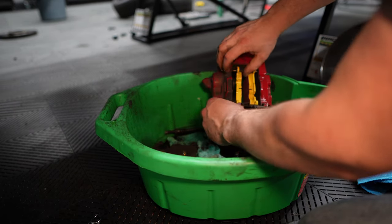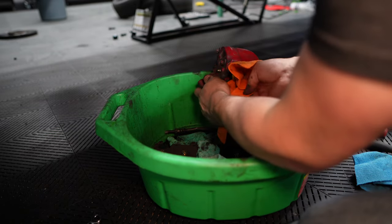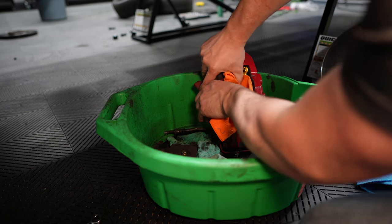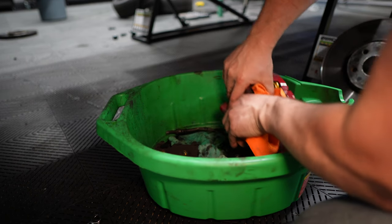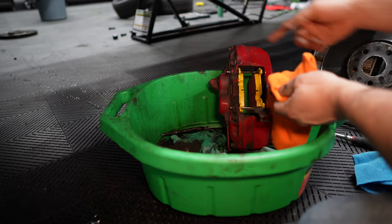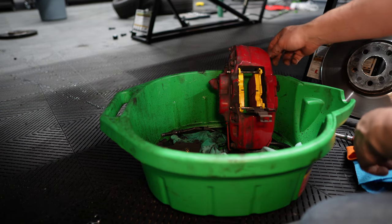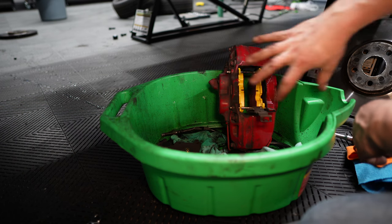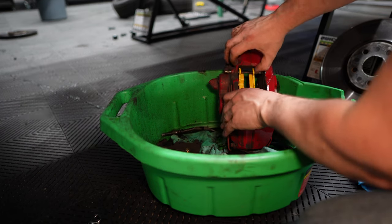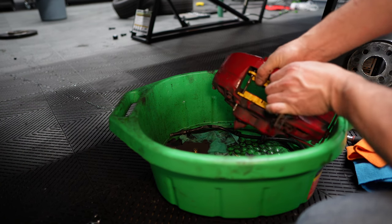Take two of the adhesive discs, peel the backing off, stick them on your finger, go in here and snap them into place — do the same on the other one. Now using an old pad and a rag, we can push the two plungers in. Because I have the lines off, I was able to push them in directly. If you didn't have the lines off you might have to crack one of the bleeders — there's a bleeder here and a bleeder here, it's pressurized, so opening one should be enough.